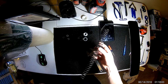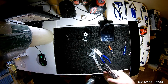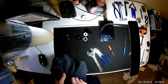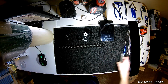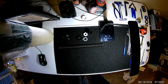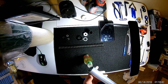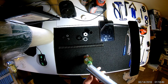And at this point, I'm going to set some stuff down and grab a rag. You can see my hands are already very oily, and I do not want to make a mess. Okay, so the spring's wiped down. Move all the tools out of the way and go back to the fork tube. So once the spring's out, not a bad idea to grab your bottle or whatever you're dumping your old fluid into and try and dump out some more. The spring kind of likes to hang up fluid. You can see how much more I got out just by removing the spring.